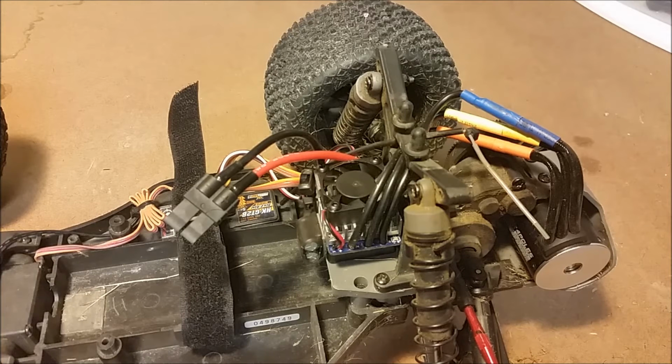Right now, this thing feels like it's really soft right off the line, and then the power comes on hard shortly thereafter. Because of that, when you goose the throttle, it starts to take off easy, then bam, it surprises you and wants to lift the front end. I'm going to play with the speed control a little bit. I think I'll probably actually increase the punch control and let the slipper try to accomplish a little bit smoother delivery of power. I'd rather have the speed control just hit when I pull the throttle as opposed to coming on strong a little after you pull the throttle. But we'll play with it. I don't know what other features we may have. There may be timing options, so on and so forth, that'll allow me to dial it a little bit better.